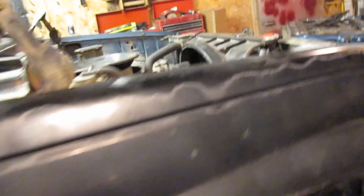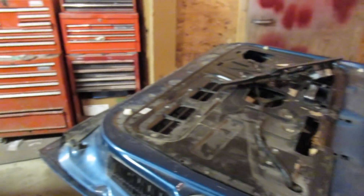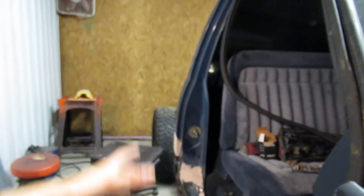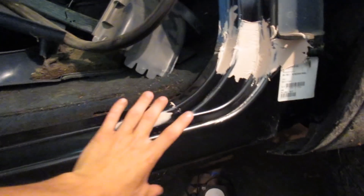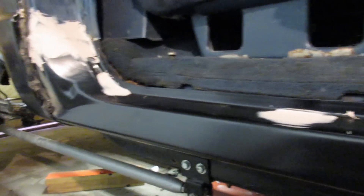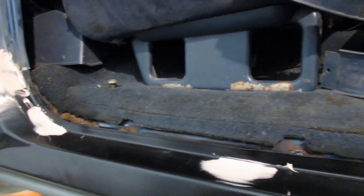Got a little dent there I'll have to fix. The plan for the truck is to get the doors all sanded, cleaned up, and jammed — get them hung back on the truck once we get everything else jammed inside. Then we're going to do a truck bed liner down the bottom, just to help with wear when you climb in and out. We're going to put the truck bed lining down — it works tremendously to help fight rust and stop paint flake. Not sure how high we're going to go, but you can paint over it and it helps with rock chips and boot marks.